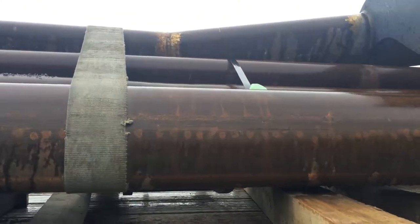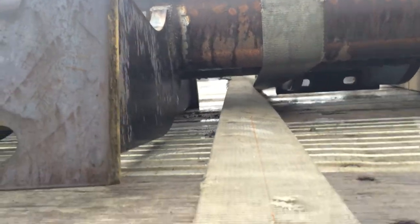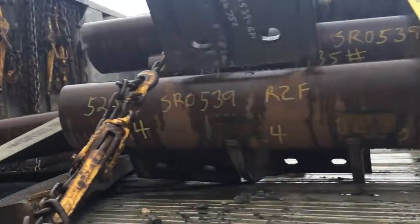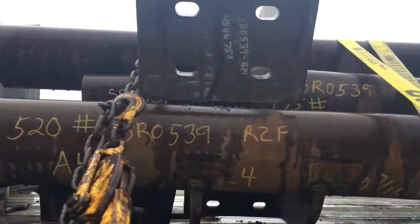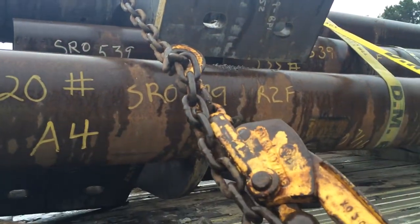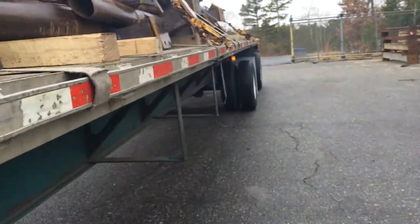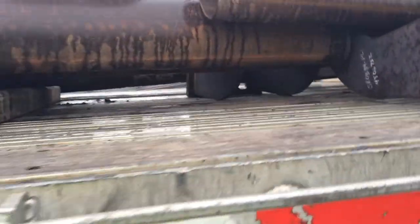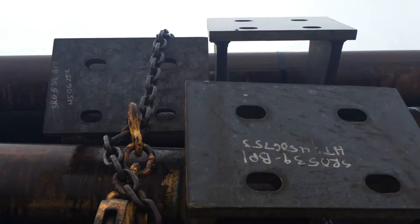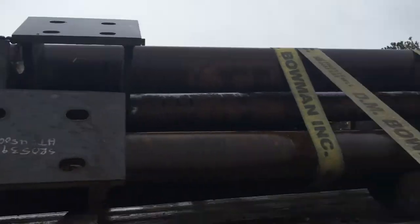I don't trust the metal banding anyway. So I use a cinch strap technique here and here. This straps over the top and this chain is over the top — for forward movement — and also threw that on top just for extra measure. That kind of cleans up the first section. And then your second section here, obviously chains up over the top and right there would prevent any forward movement.